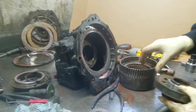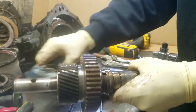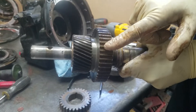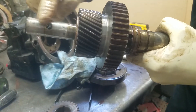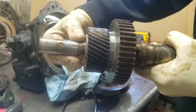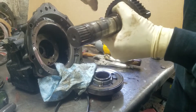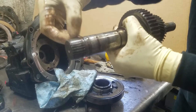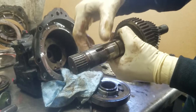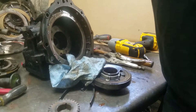We'll take a look at the input shaft — this is the clutch hub. We're making sure there's no discoloration. We're also looking at where the bushings ride going into the planetary — all the gears look well. Looking at the spline of the input shaft: it should be nice and crisp and sharp like this. You can see there isn't any wear there, so that's good.